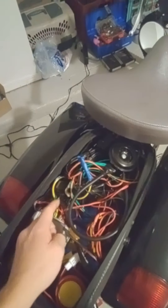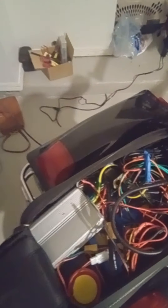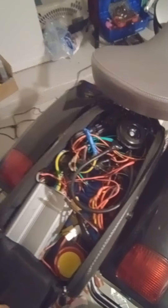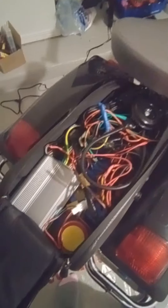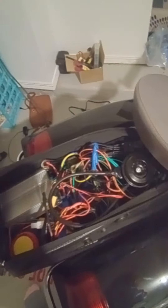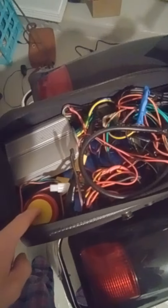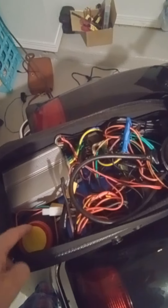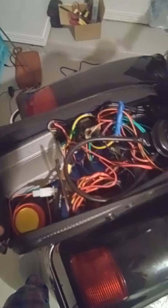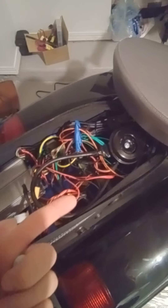That little relay came off that scooter, and my camper van had a horn just like this one also off the same scooter — because the original big camper van horn with the two discs seized up and I couldn't get to it without taking the grill off on those old B-series vans. So I installed a scooter horn on it. It made it legal but it wasn't that loud on the highway for a full-size V8 van. On this e-bike though, this size horn is perfect — it actually has a higher decibel rating than the security system siren, about 10 decibels higher.